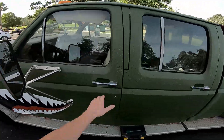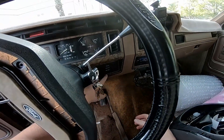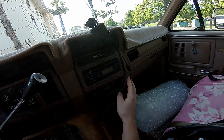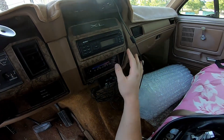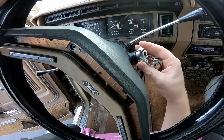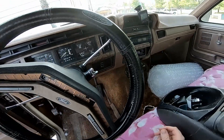What's going on everybody, Grim Repair here. I've come out today to start my truck and put my key in and turn it. This is a diesel — I normally get a glow plug light and I noticed I wasn't getting it. But I also noticed that when I wiggle the key and get it in the sweet spot, my radio kind of flashes like it's getting power for just a section of this turn. I turn it and it starts, but I think I need an ignition switch.